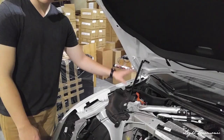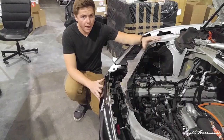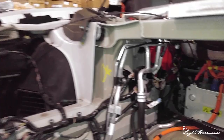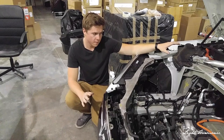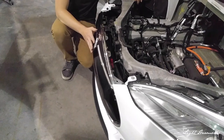We've just gotten to our fuse box and removed the air box. Now a few important tidbits: this nose cone comes off, and once — before we actually killed the car — the battery pack had plenty of charge, but there's actually a 12-volt battery that's orange, located back there, that runs a lot of the standby systems. When we originally had the car apart, we completely drained those standby systems. The car was dead — we couldn't start it, couldn't turn the head unit on. You can actually jump-start a Tesla if this happens. Remove the nose cone and behind it there are two posts: a red post and a black post. You can hook your Tesla up to those and recharge the 12-volt battery. Once it's at 12 volts, your car should turn on and start as normal.